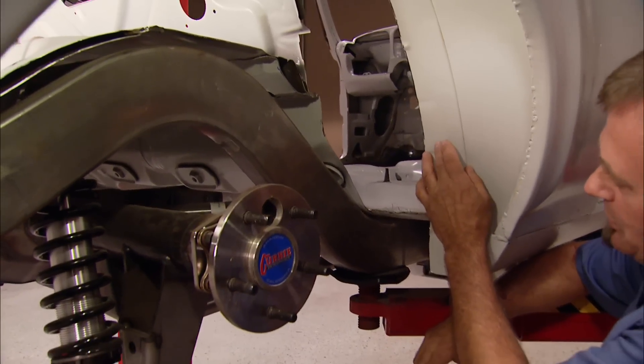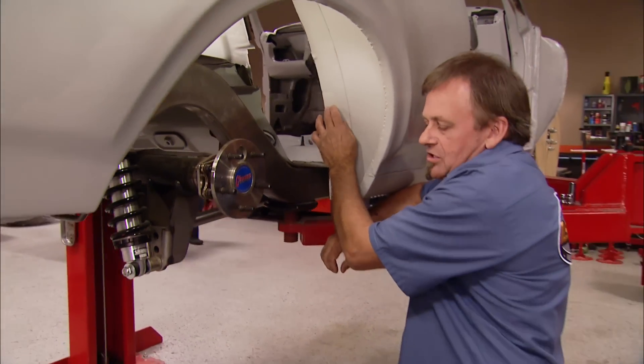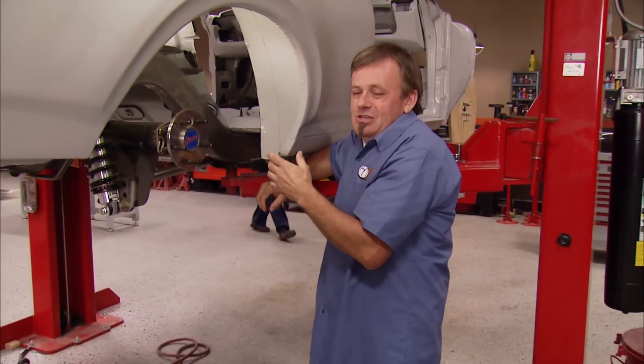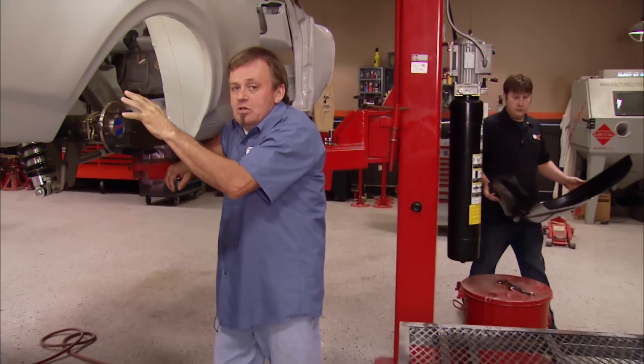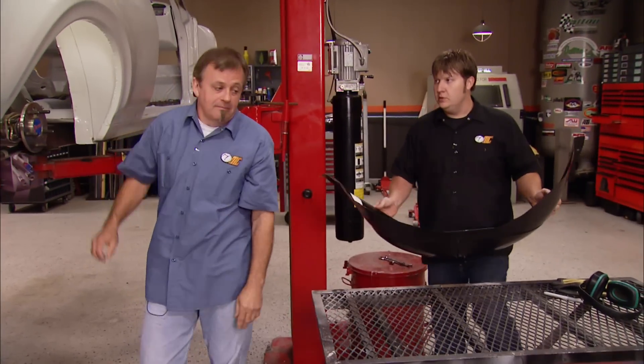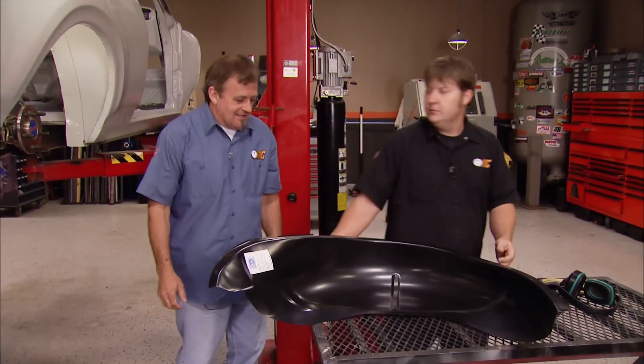What we'll do is use the factory seam to anchor the new wheel wells. We'll use this seam, which will give us another two inches or so of room — great for suspension travel as well as the new wider wheels and tires. What we're going to do next is remove the vertical seam here because we left the outer half of the wheel well in the car, and we're going to shave it all the way around so that we can get an overlap between the new half and the old half.